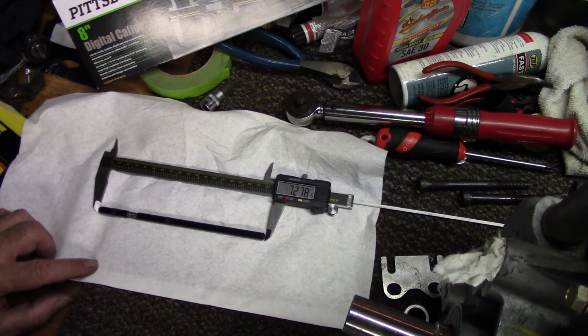So I hope you all enjoyed it and learned something. That's it for this video. Hope you learned what it takes to measure for adjustable push tubes. Sorry, not push rods, push tubes. It's not real hard if you've got the right tools, but it is a crucial part of building the engine. They have to be the right length so you can get your adjustment. These are really strong springs, so we're going to have extra heavy-duty push tubes made to handle that spring pressure. If we used a stock-diameter one, they wouldn't last, if they lasted at all, one rotation of the motor.